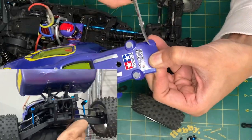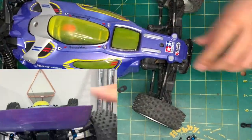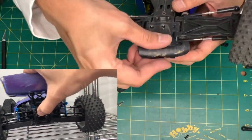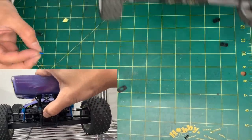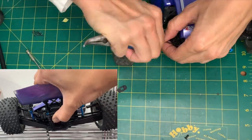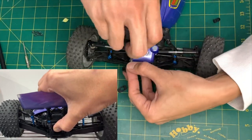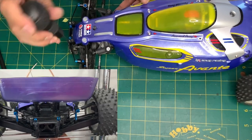So where do they work and how do we use them? Less roll means less steering grip because the car isn't allowed to roll onto its outside tire as much, therefore transferring less weight — but more responsive and more direct handling because more of its tires are on the ground. More roll means more steering because it's allowed to transfer more weight to the outside wheel, but slower response time because it has all that movement range available and less tire contact. So it seems like it's all about finding the balance in your chassis and the way you drive.